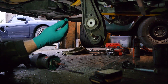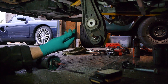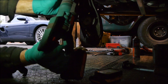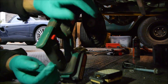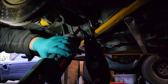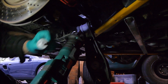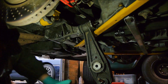Just carefully trying to cut between the aluminium control arm and the aluminium subframe - it's a steel bolt. You want to work towards sacrificing the arm because it's going to be scrap anyway, and do not cut into the subframe. We're going to cut on the nut side first, then the bolt side, and then get down the other side - that one looks a bit trickier and tighter.